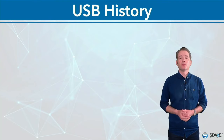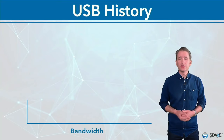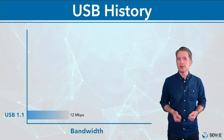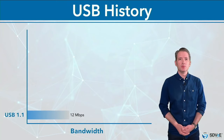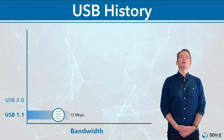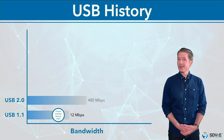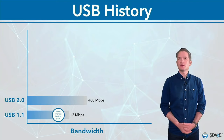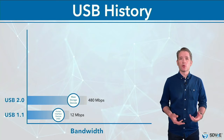The Universal Serial Bus has been a familiar friend since 1996, offering a much simpler way to connect devices such as keyboards, mice, and printers. In those early years, USB 1.1 gave us up to 12 megabits per second of bandwidth — also known as full speed — plenty for those tabletop human interface devices, commonly referred to as HID devices. By 2001, USB 2.0 came on the scene with 480 megabits of bandwidth, also known as high speed, ushering in convenient-to-connect sophisticated products such as mass storage devices, thumb drives, high-speed network adapters, external displays, and streaming cameras.